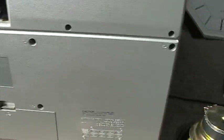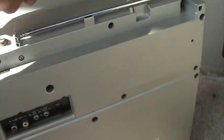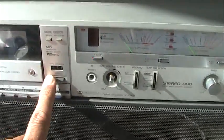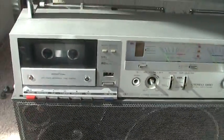It's in pristine condition except the cassette deck does not work — it probably needs a new motor. The belts are okay, but it needs a new cassette motor and a belt for the tape counter. I found a regular old rubber band from a newspaper in there.